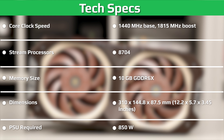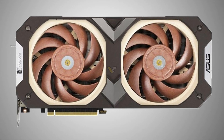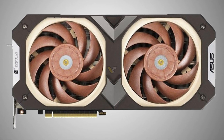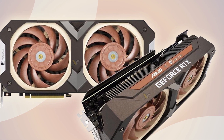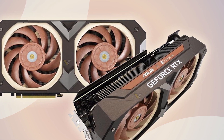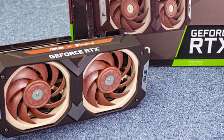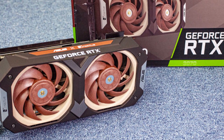The cooling solution is based upon the Asus TUF model, with the heatsink width increased to 120.50 mm, height to 42.20 mm, and depth to 94 mm, along with an increased copper baseplate sized to include the memory chips for improved thermals. This is supported by two Noctua NF-A12x25 fans for optimized airflow through the heatsink to dispel all the heat.